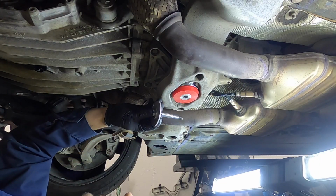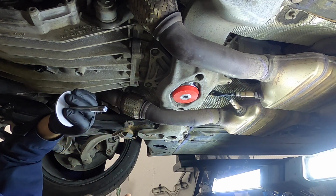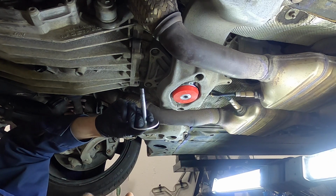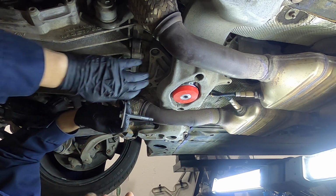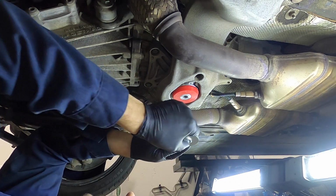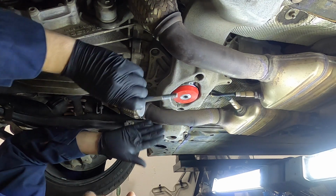Moving on under the car, so Doug at Apikol, the same people who made this mount and a few other ones I installed back in episode 2 or 3, he saw my video and said, "Steve, cool idea with putting the hardware upside down, but keep in mind the design of the bracket and transmission was never to do that, and make sure that if you're taking a bolt and shoving it all the way up there, that you're not driving the end of the bolt into the bottom of the transmission and cracking it."